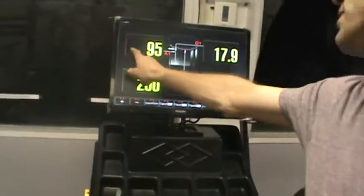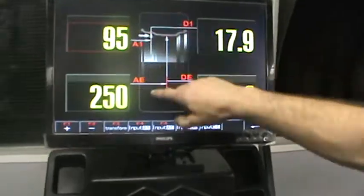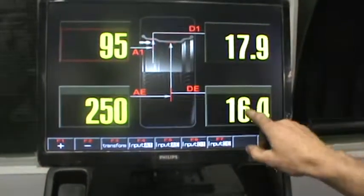What these boxes represent is the ruler distance to your inner stick weight, as well as the inside diameter of the rim. And here, the ruler distance to the outer stick-on weight, as well as the inside diameter of the rim.